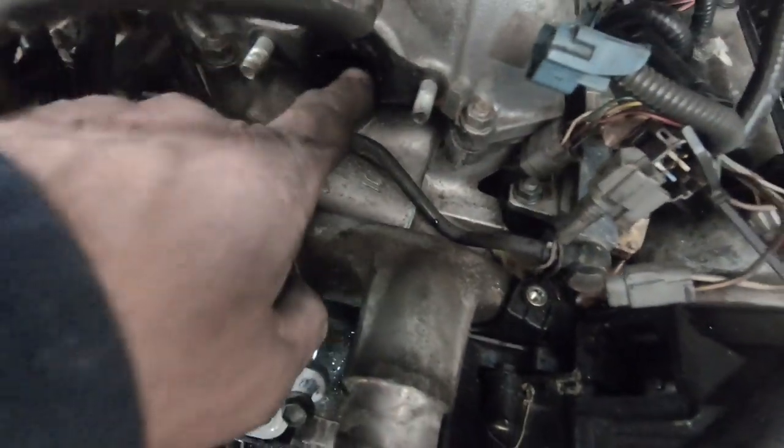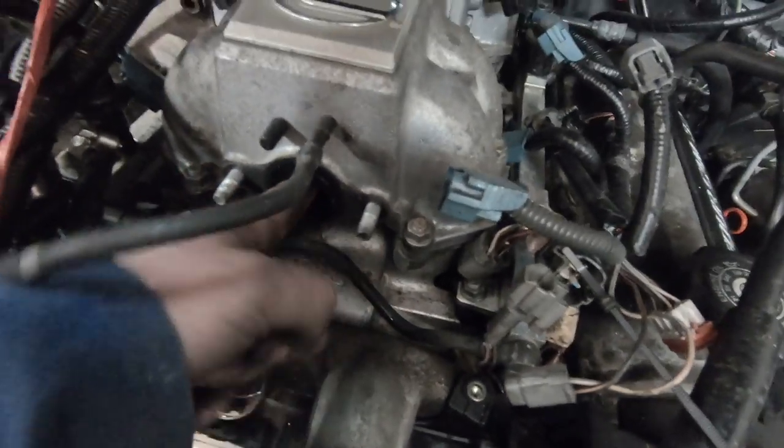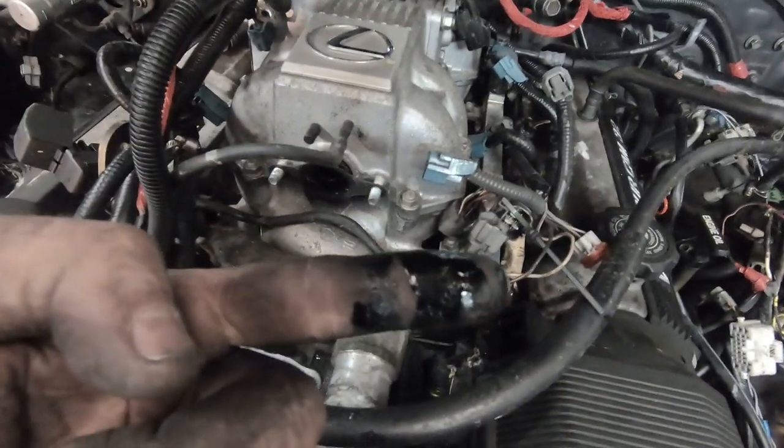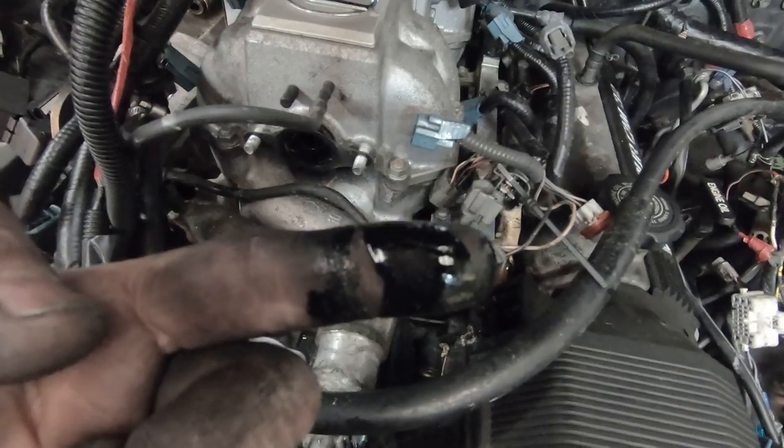Sticking my finger in here, give it a bit of a turn around... I think that's bad. I wouldn't put an engine in without checking it properly when it had that black gunge through the idle speed control.